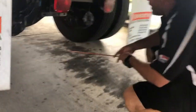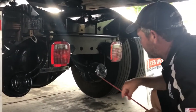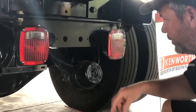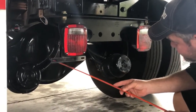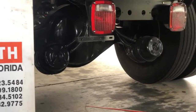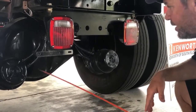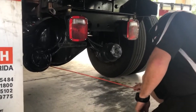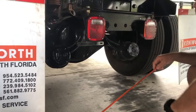I'll be checking my brake drums and brake linings, same as the front axle. I'll be checking the brake chambers back here — I have a dual chamber back here. Make sure both chambers are securely mounted to the truck, the clamps are in place, and there are no dents or cracks to the chambers, because spring chambers can rust out, start cracking, and the spring can come out. I'll check the hoses going to them — all nice and tight and secure in their connections, with nice attachments keeping hoses from rubbing and dry rotting. I would check for leaks in these hoses and chambers by building air pressure off the governor cutoff, pushing in the yellow button to listen for air leaks on the emergency side, then applying the service brake to listen for leaks on the service side. I can also pull on the slack adjuster to confirm no more than one inch of play, and check the push rod and slack adjuster for cracks, bends, proper hardware, and proper lubrication.